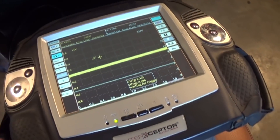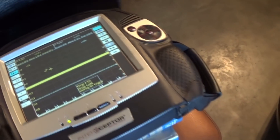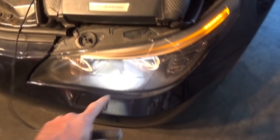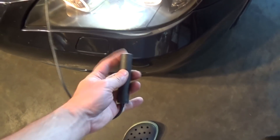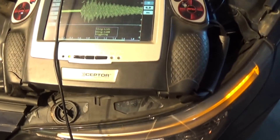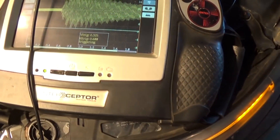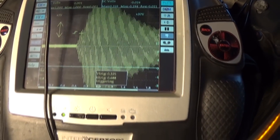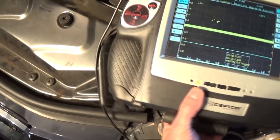Nick is in the car and he shifted into reverse for the sensors to work. Let's see the signal from the driver's side. I really have to put my probe very close to the sensor to pick up the signal. Actually from this distance you can see a signal, and when I put it right up against it there's a clear signal. Of course this one is missing — let's go to this one here.